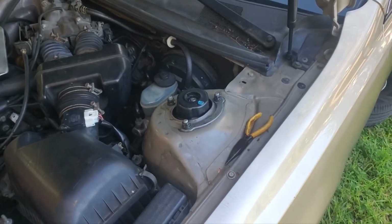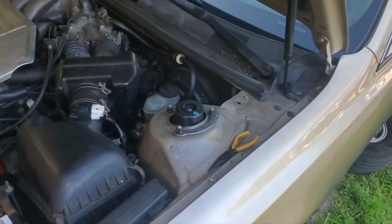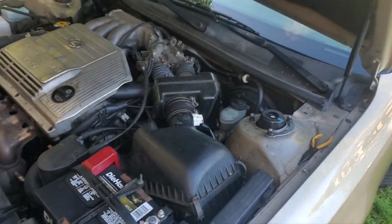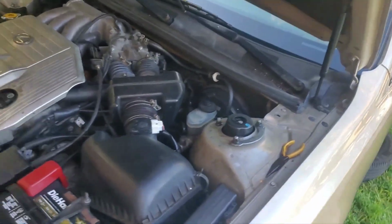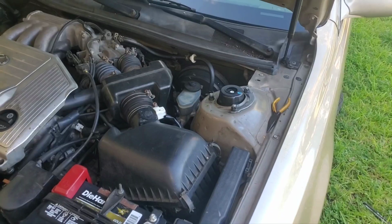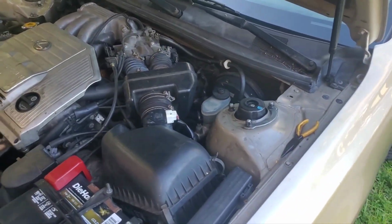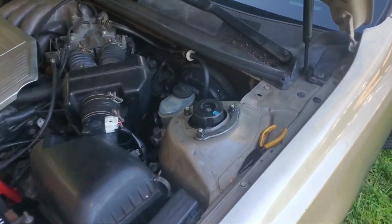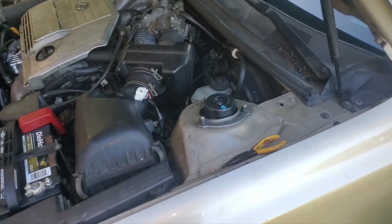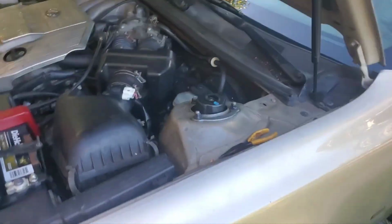Day two, it was getting these struts and putting the strut mounts on. Now, that's where you're dealing with those spring compressors. You can go to your Advanced Auto and get the spring compressors. A lot of people are afraid of them. I understand why. I've done it a few times now, so it's not as scary for me. Obviously, you want to be careful, you want to respect it, and you're going to be hurting your hands and your arms doing it, because there's a lot of pressure that you gotta just keep turning, and I had to do it multiple times to get it to line up.